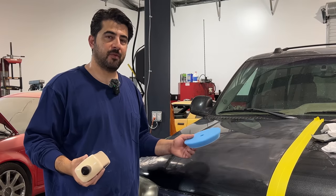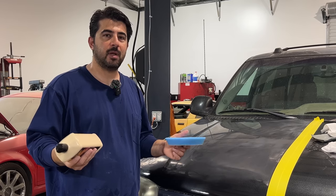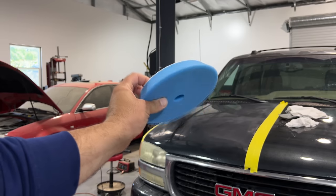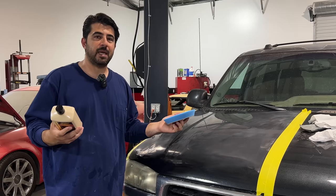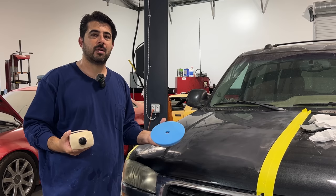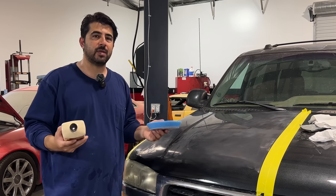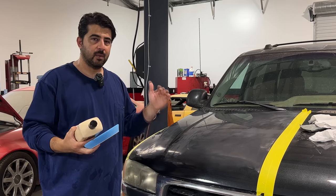Next up we go to compounding and polishing. When we talk about cutting compound or compounding, we mean using a heavy duty cutting compound with a coarse foam pad or a wool pad to go over heavy scratches like the 2000 grit sand scratches on this panel. There are quite a few manufacturers — I like to use Meguiar's for both cutting and polishing. Waffle foam pads actually work better than flat ones. The wool pad cuts more and quicker but it's a little more dangerous, especially if you're new, depending on what type of buffer you're using.